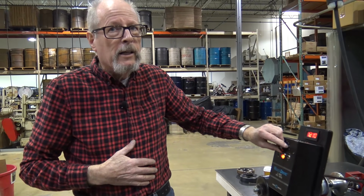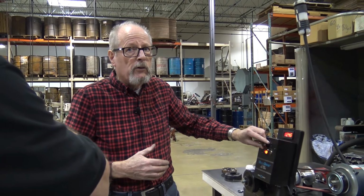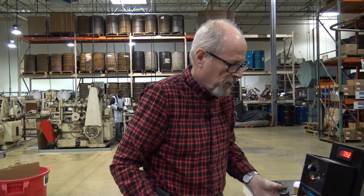And I don't want any of my clutches coming in higher than 7,000 RPM because all my clutches are dry clutches. An oil bath clutch like a Hartmann, I can put a Hartmann on here because Hartmann is the exact same size as a Max Torque. And as a matter of fact, so is the Hillard, the same size as a Max Torque. We both use a 4-inch ID, inside diameter of the drum.